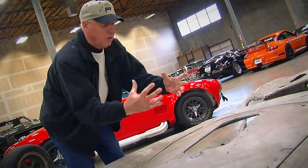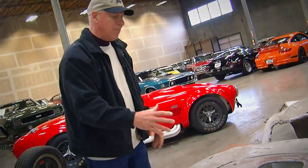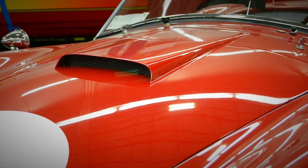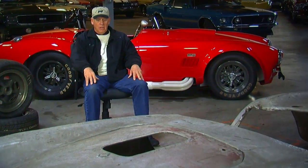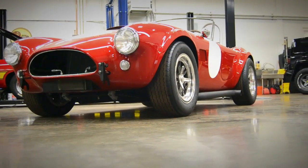The Webers were a carburetor that didn't have any kind of air filter over the top of them — they were just straight right there. You had this little metal shield right here in front that stopped the gravel and stuff from coming down and dumping directly into the carburetor. They had the air scoops down in the front end — about six inches wide — and they scooped right up, connecting directly into the front disc.